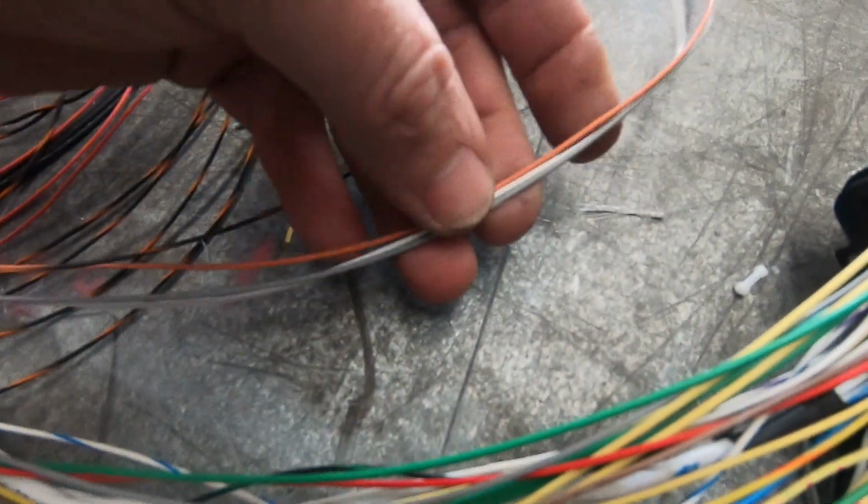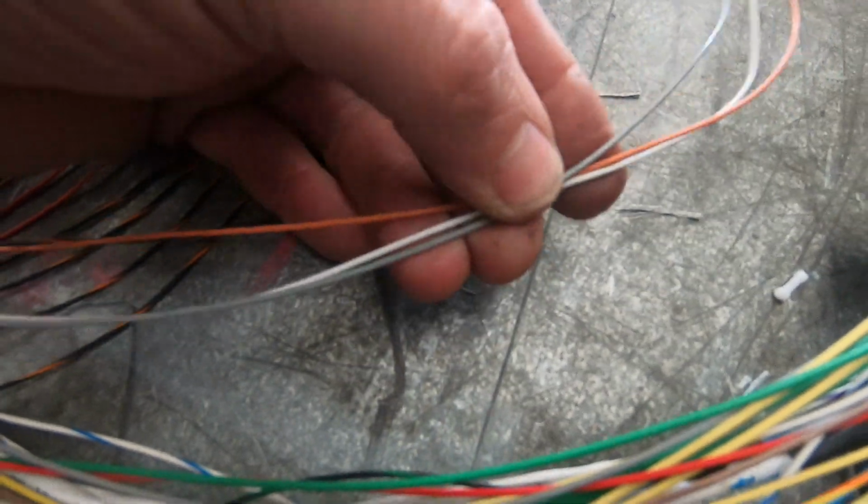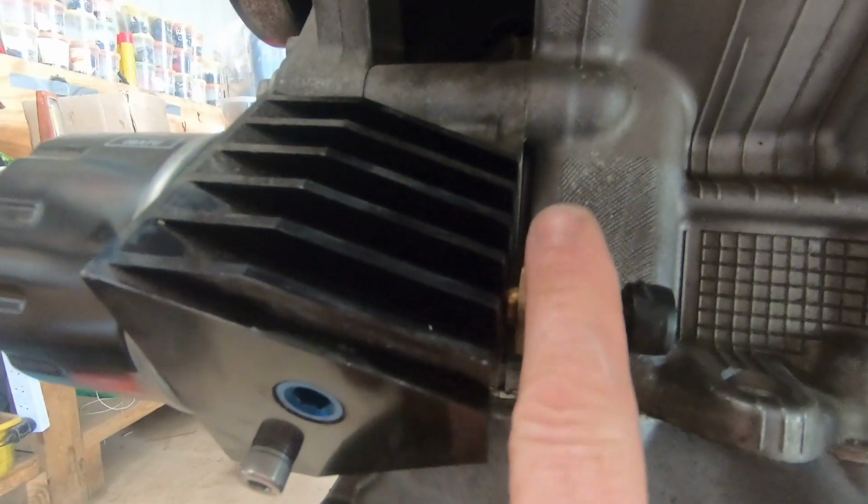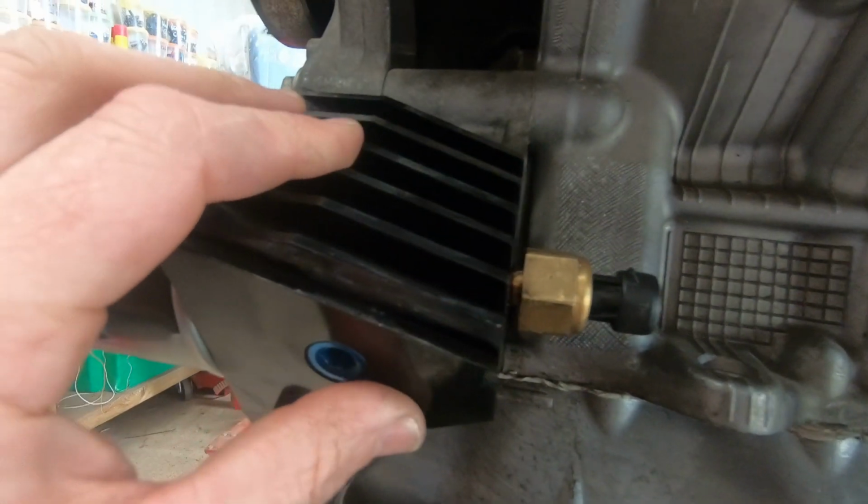In my loom, harness, I should call it a harness so everyone understands. There were these 3 different coloured wires, so they're alternator. And there were these 3 coloured wires. I'm starting to run out of sensors on my engine. However, I'd put oil pressure, fuel pressure, and oil temp into the loom. So I'd put those sensors in. Oil pressure and fuel pressure are both on a 5-volt supply. Got little pressure sensors. So these little fellas, and I find these are just amazing little units, great little units. Very simple, very easy to use. So I've got a 5-volt, an earth, and a signal coming back to my ECU from the sensor.